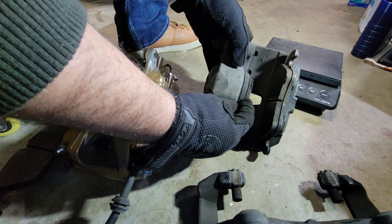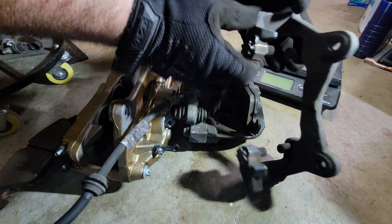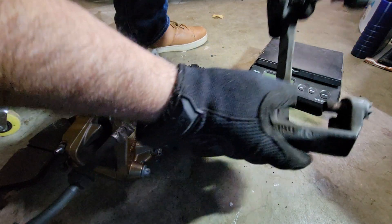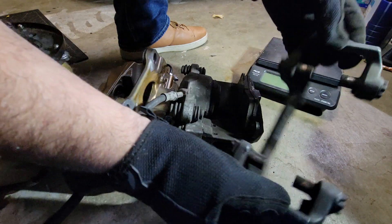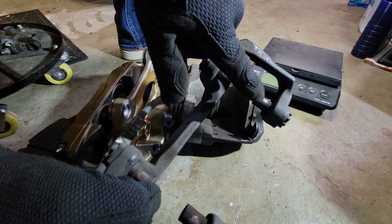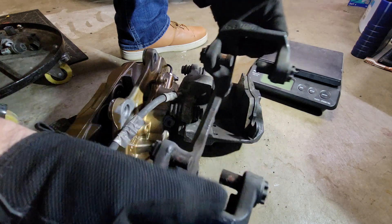You can see it's even partially extended right now. Then this whole caliper body slides on this bracket. You can see the little metal tangs here where it would actually slide. And you can see they are seriously dirty, beat up, scuffed, not very smooth and nice looking. In fact, you can see the wear marks from where the caliper sits and slides on just one small portion of that whole round piece of metal.